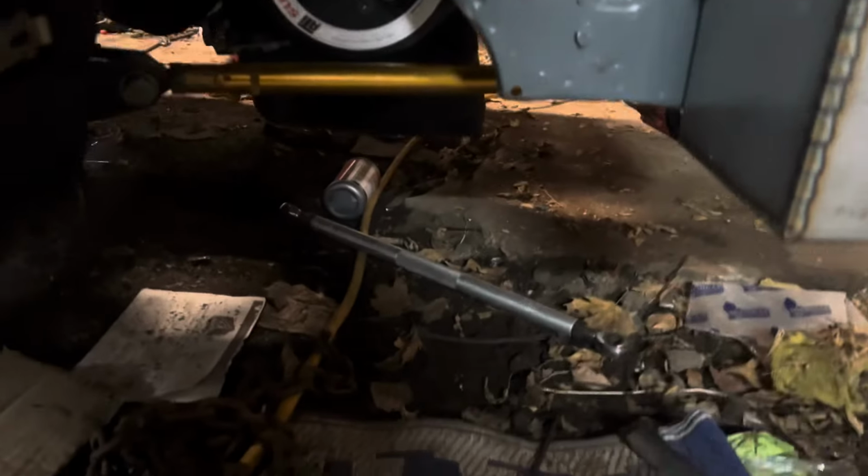I'm not gonna lie, I'm a little frustrated. I got the weight plate off, obviously, and I got the K-Tune one mounted up. Everything's hanging like it was before, and if you look, the Full Race bar worked in theory, yes, but I'm missing half the bolts on my K-Tune bar over here to get it to swing forward to make it work, because these arms are too long. The Full Race bracket goes to the control arm, but the Full Race radius bars are too long to where the K-Tune should mount up. Even turned all the way in, it's still not mounting up. So now I'm trying to figure out, do I bite the bullet and just buy a whole new K-Tuned traction bar? Because you can't find the radius arms.